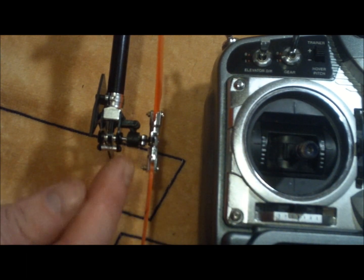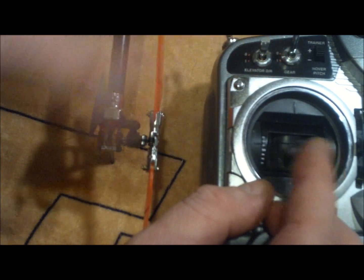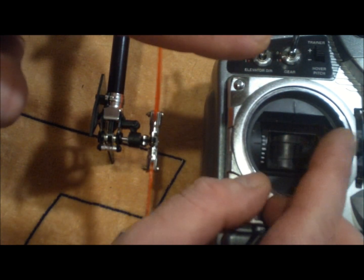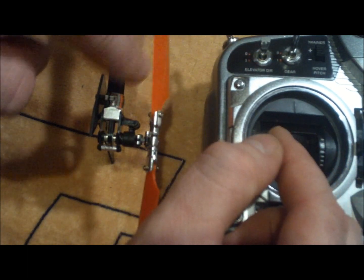What you want for a T-Rex helicopter, you're going to want the slider to go the opposite direction of what you turned. So if you turn left, you want the slider to go right. This is actually the wrong direction — it's going the same direction as I'm turning the rudder, so that's not what I want.